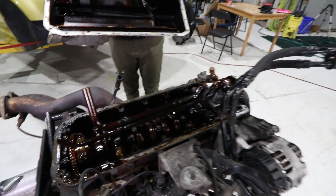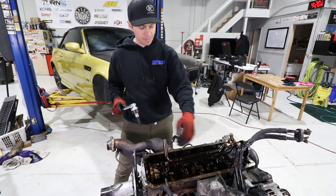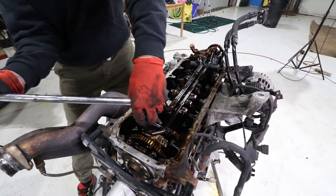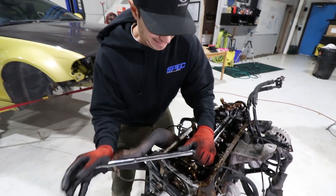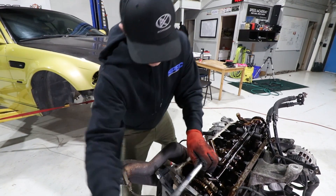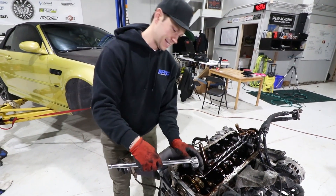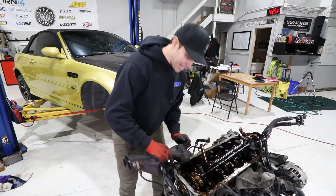Look at the patina in there. As you can see, the oil pump and pickup are in the way of most of the rod bearings, so we're going to start at the end — this one is conveniently positioned upward. We're going to back the bolts off nice and slowly. With the bolts out, it's time to gently tap the rod bearing cap off.